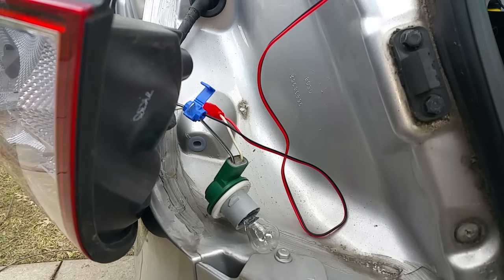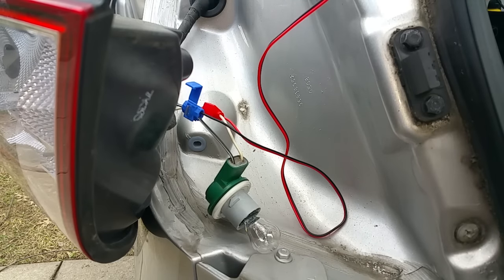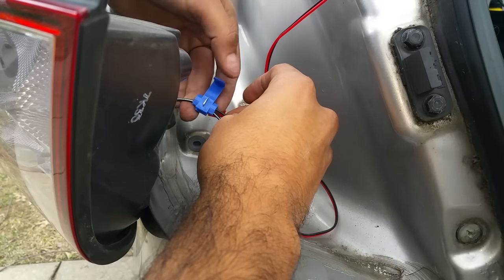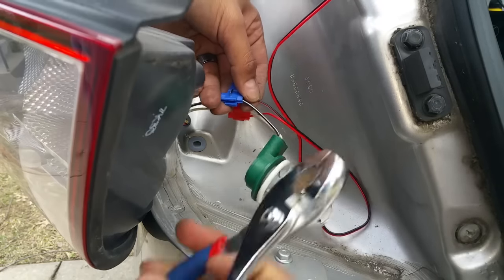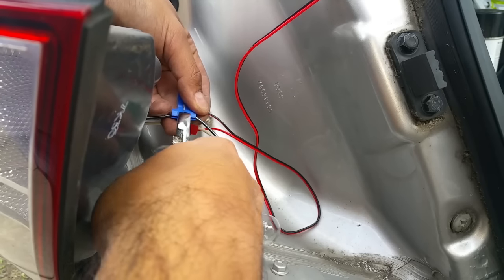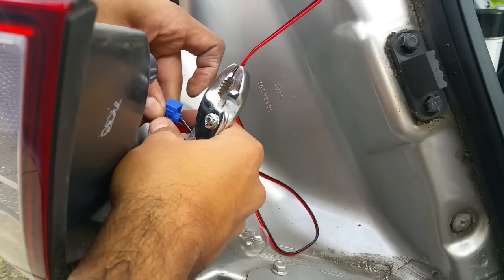Did it with the red wire. With a multimeter I went ahead and grounded it on one side and tested both of the cables — found out that one was going to be my hot wire, and this one was going to be my ground, my negative. So everything was pretty good. This one slides in there, and then this one goes in there. Once it's in, I like to use a set of pliers to give it a gentle squeeze. Now they're connected and should have power to them.